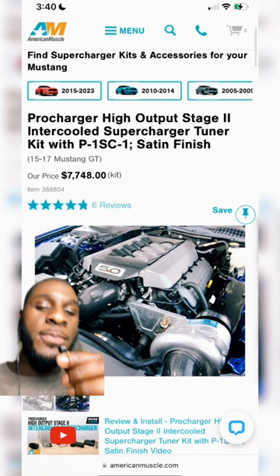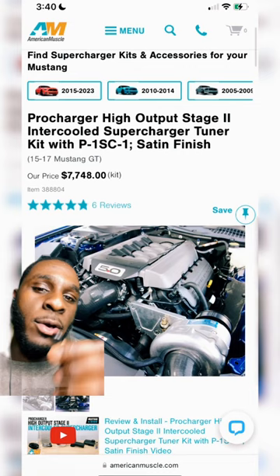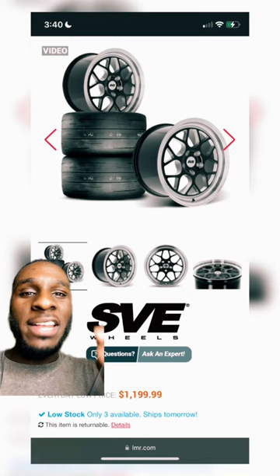Side note: you really don't need to change the intake manifold, but it's all up to you. Some people like the Boss 302 intake, other people just like to maintain the stock manifold on these gen 2 coyotes — it all depends on what you like. Set it on the drag pack, give it an E85 tune, and you've got 700 to 750 horsepower.